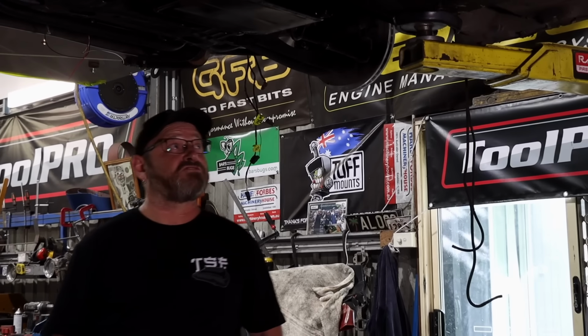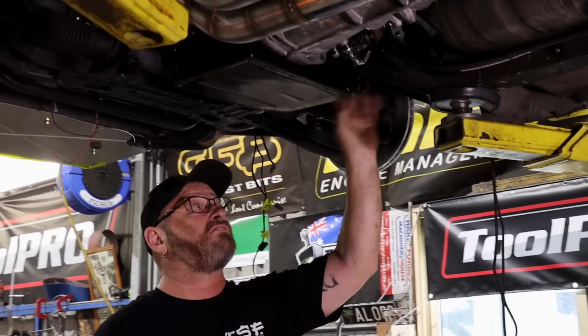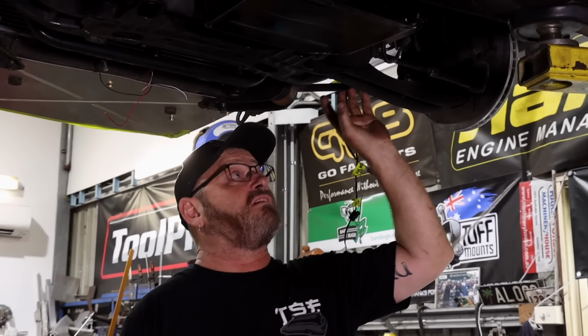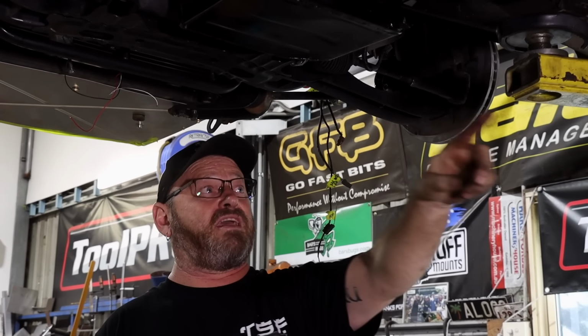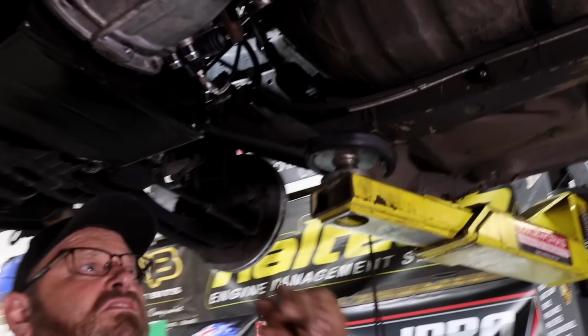Oh. We've got those fuel lines run for the most part. We're still missing a couple of fittings that we're waiting on, so we'll finish it off when we get those. We've run the dash 8 from the tank through to the rail via a filter for 10 micron, I think Woody said it was, which is the finest.